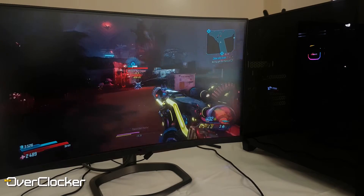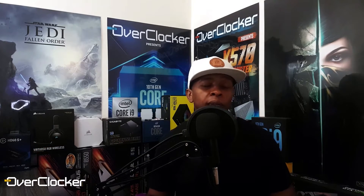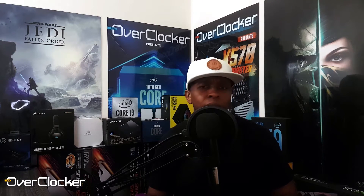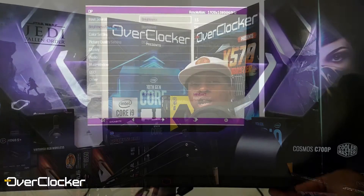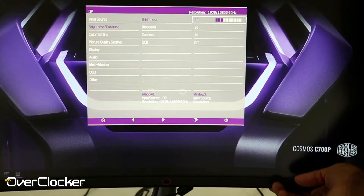It's a VA panel, which I think is sourced from Samsung. I don't know what kind of tuning Cooler Master has done to the panel, but from where I'm standing the image quality looks pretty nice, especially when gaming. When it comes to text it can be a little fuzzy, especially white text against a black background — when scrolling up and down there's a little bit of a cut-out effect. It's not a major issue since this is a gaming monitor, not for typing long documents, but just be aware of that. I think it's something you can address using the OSD.